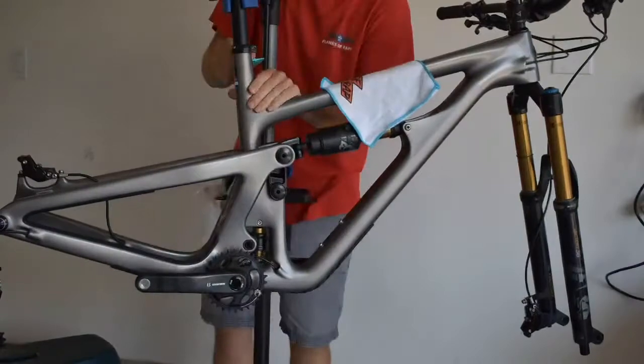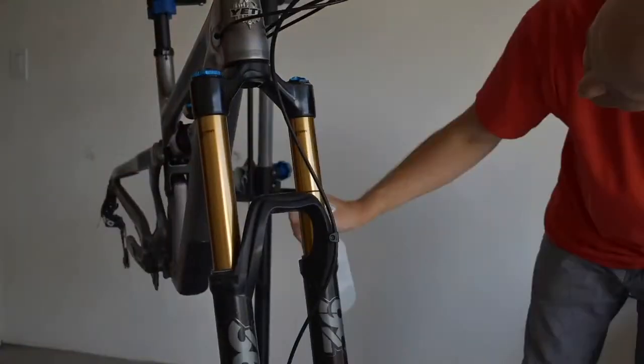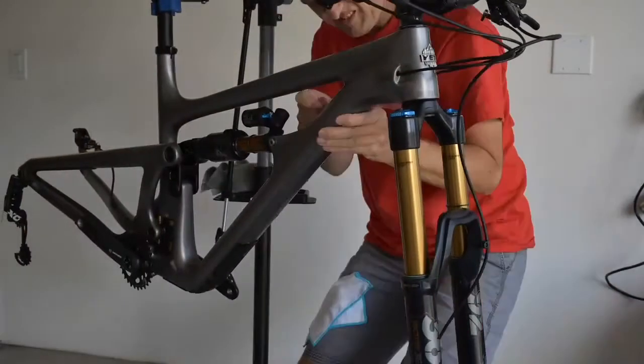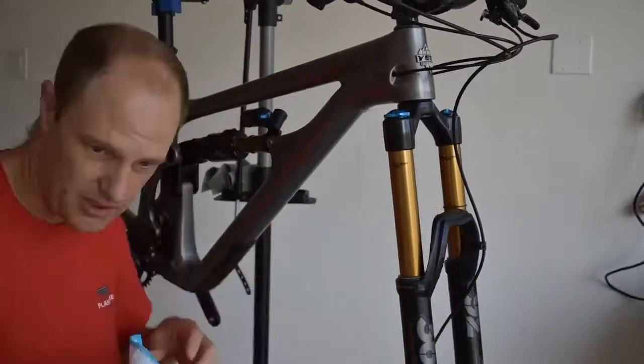If you do end up getting some air bubbles in there, it's pretty easy to work them out. You just very carefully start peeling back the area closest to the air bubble, and then re-squeegee it. Keep it all very wet, let it dry, get the microfiber on there, have another look, make sure the bubble's not in there.